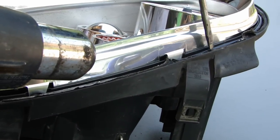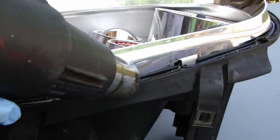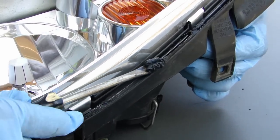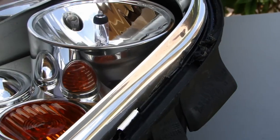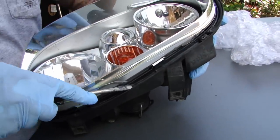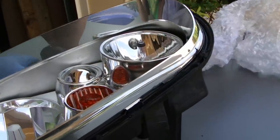You don't want to get this stuff too hot, but you want to warm up all this area right in here. See how it's getting gooey? This stuff was rock hard just a few degrees ago. What we're going to do is heat it up and pull it all out. Take your flat blade and just start prying. I should have had a rag handy — you can even just use bubble wrap. See, it comes out pretty easy but then gets tough in the back because it's not up to temperature, so we're going to go back to heating.